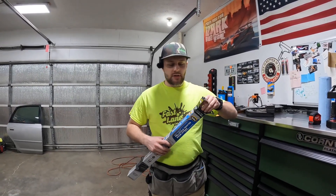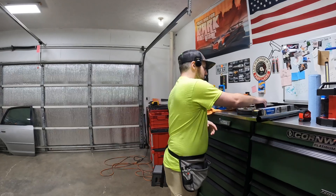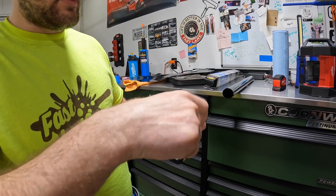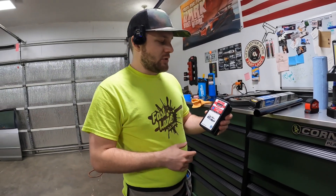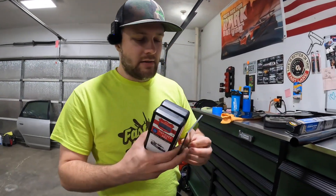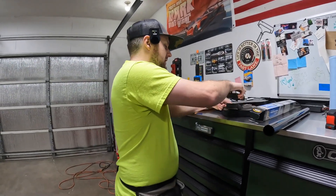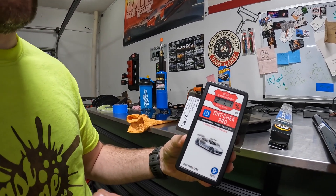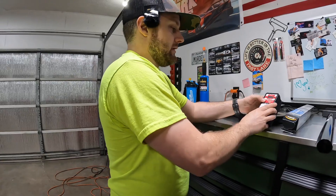Come over here to our light meter — it's Tint Check Pro. This is basically the same company that makes the clip-over deals that law enforcement uses. You put it together and it reads 100%, meaning it's ready to go. We're going to verify it's calibrated using the check slides — we're looking for about 27.8. We get 27.1, so we're less than 1% away, well within tolerance.